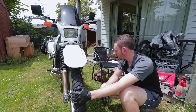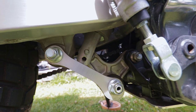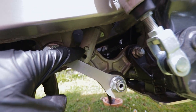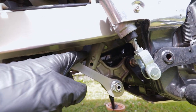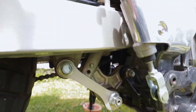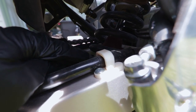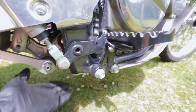Right, let's have a look at the back. This is the back suspension here, the lower linkage. If you see this bolt here it's in the top hole — there are two holes, so this is currently in the lower position for the bolt. If you want to do the shortcut way, just jack it up and swap that bolt around. However, there is a collar in there on the bottom of the bump stop which needs to be turned down as well. Otherwise you've still got your suspension travel but you don't have the ground clearance.